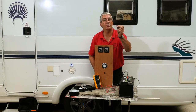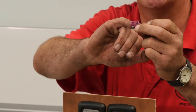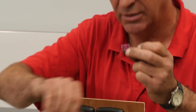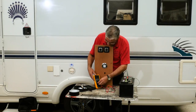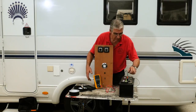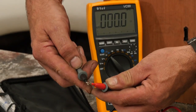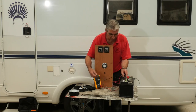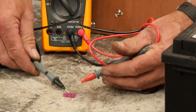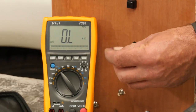If you're checking a fuse, don't just look at it. It can look perfectly good but still be open circuit, especially a small fuse like this at three amps — the wire inside is like a hair, it's so fine. So when checking a fuse, test it with the meter. We do that by switching to ohms resistance. To make sure the meter's working, touch the two prongs together and we read zero; separate them and we get OL for open circuit. Put the prongs across the fuse and we get a reading of zero — so that fuse is good.